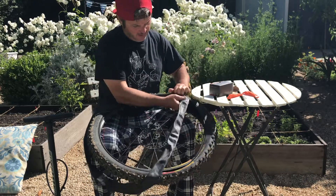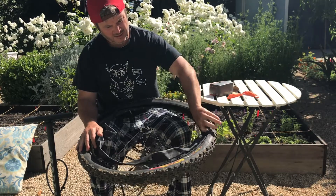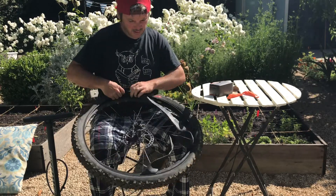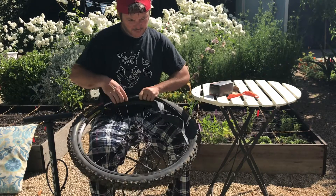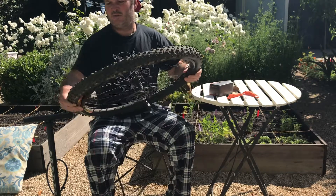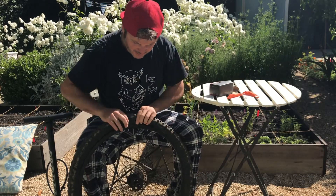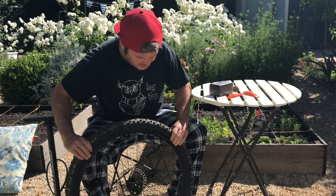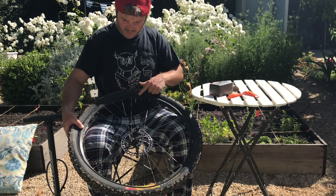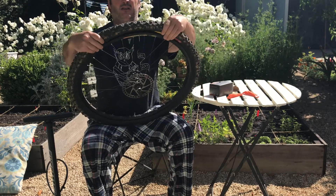I'm going to place the tube back inside the tire — I like to put it on my lap. Now the tire is open and I can get the inner tube to sit inside the tire. So I'm going to go around and stuff the inner tube inside. Once I've got the tube all the way in, starting at the valve stem, I'm just going to pinch here and get the seat of the tire to go on the inside edge of the rim. So you can see right there I've done it, and I'm just going to squish it all the way in.